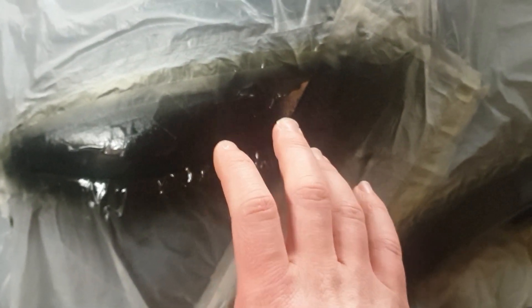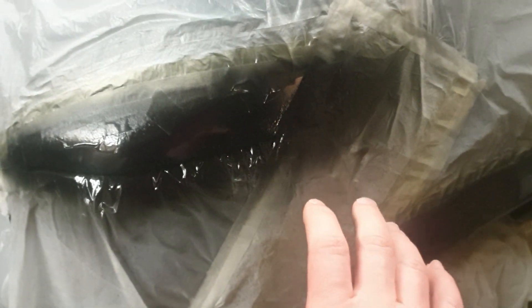So the two areas - the arch and the boot - all in all they have had two coats of primer, five coats of paint, and two heavy coats of lacquer. They've currently been sat a few hours drying out. Obviously I'm going to leave it 24 hours to properly harden. As you can see by the reflection of this, I am really happy with the result.